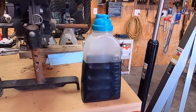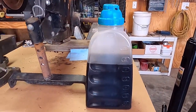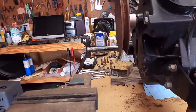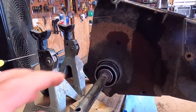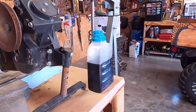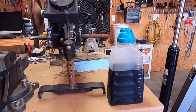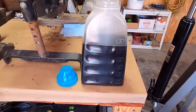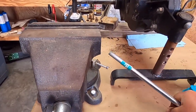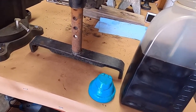What I got was almost three pints and it seems like it's 30-weight by the way it pours — kind of dark, probably the original oil. I'm thinking that seal — that was just seepage, there was no leakage there, so we're just going to clean that up. I do have new seals on order, we'll pop them in. I'm going to assume three pints is what this takes, and without a book this is the only way I've got to do it. I'm putting a neodymium magnet in there — it's a really powerful one. We'll swish this around and just see what it comes up with.